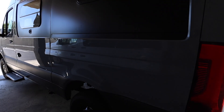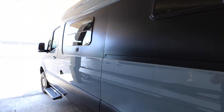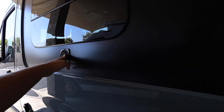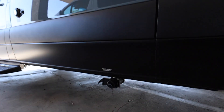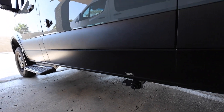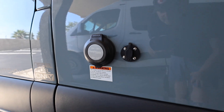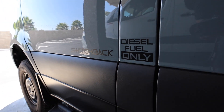Sorry if the sun and glare makes it a little dark here. You've got another bunk bed window. It's a really nice feature — the CR Lawrence. This will open up so you get a lot of ventilation. This is ventilation for the kitchen galley area for electronics and water. Down here is your sewer out. There are no water tanks on the exterior, so it's pretty four-season friendly. Here you have an additional Zamp solar connector for external solar. You've got a 30-amp shore power. And this is diesel fuel only.